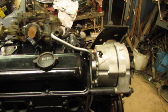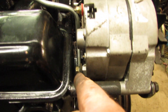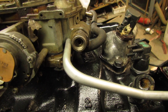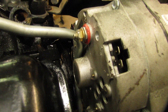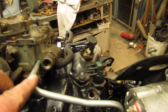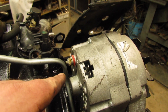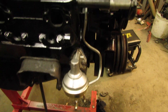Let me show you a miscalculation I made. Everything looks good up through there, plenty of gap between the alternator and everything, but I missed the carburetor by a little bit. No problem, we'll just bend this back - oh wait, now the fuel line hits the alternator. So I think what I'm going to try to do is put a bend here and one the opposite way to shorten this run a little bit and get it closer to the carburetor without touching the alternator. If it doesn't work out I can straighten some of that out.